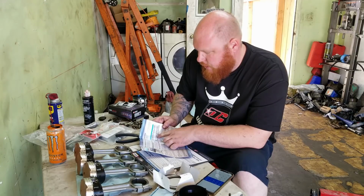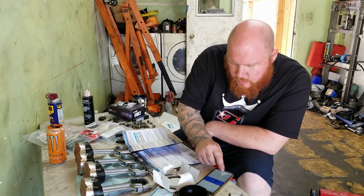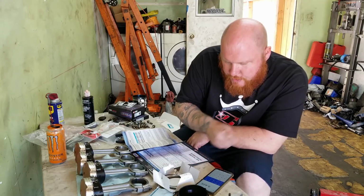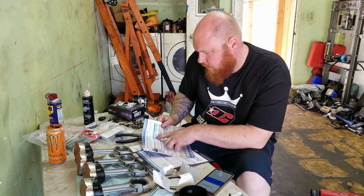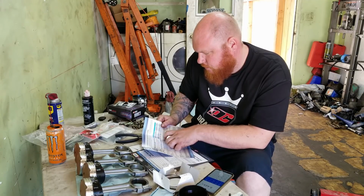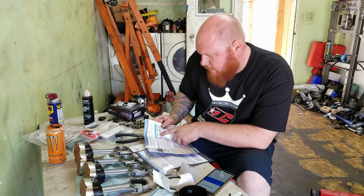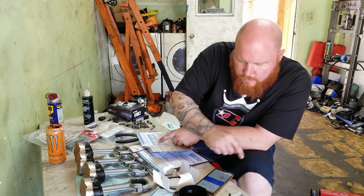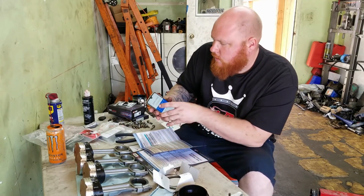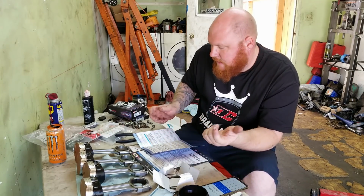So what you gotta do is take this measurement and multiply it by the bore. The bore is 3.425 inches. Multiply that, so you have street high performance, drag racing, road racing, and turbo nitro supercharger. So it's saying 0.0055 times the bore. So that equals 18.8 thousandths of an inch. So it's between 18 and 19 thousandths.